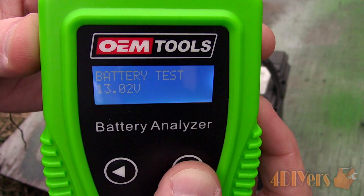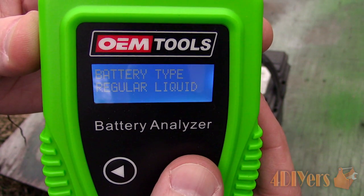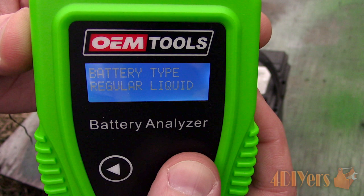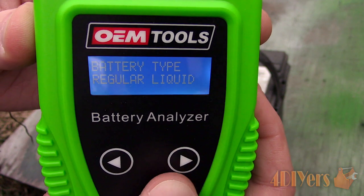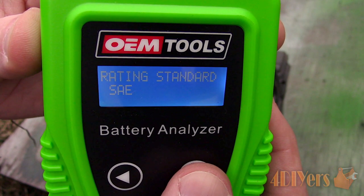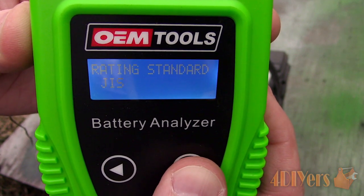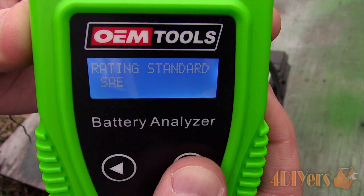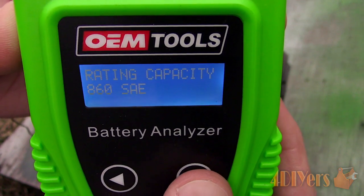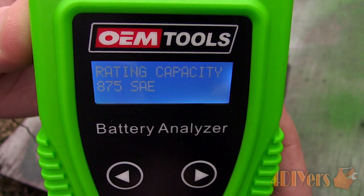Next is selecting the battery test from the main menu selection, then hit Enter. Select the type of battery you're testing — for this we're testing a regular liquid battery which consists of lead plates and sulfuric acid, the most common type used in vehicles. Then select Enter. After that, select the SAE battery rating, which is a North American standard used for battery testing, though this may vary in other parts of the world. CCA is an SAE standard. Now enter the cold cranking amps rating — the number from the informational tag shown earlier. Finally, press Enter again and the analyzer will perform the test.